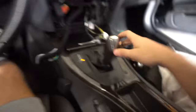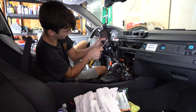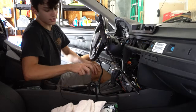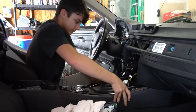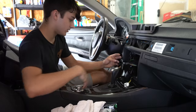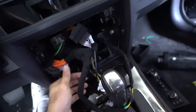To install the center console controller, put it in drive and pry the tabs up to pop the trim out. Slide the controller unit straight in. Once seated, route the one wire up to the middle piece so it goes with the rest of the harness. Take the cable routed up from the button and plug it into the harness. That end goes into the back of the radio.